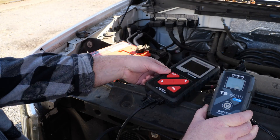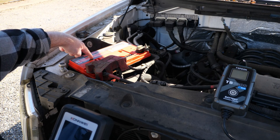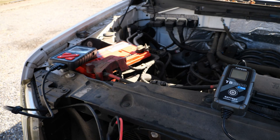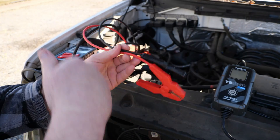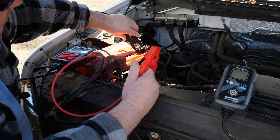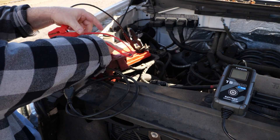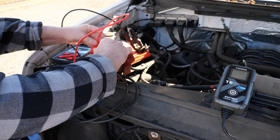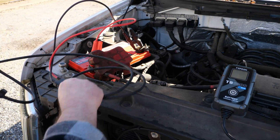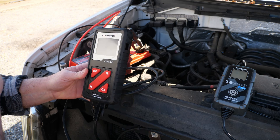This is a true multi-tool and it has a built-in battery tester, and this is a dedicated battery tester. The battery is rated for 950 CCA — cold cranking amps. These testers work on voltage and resistance; they don't load test a battery. It's a slightly different mode of thinking, but they're accurate — I've never seen one do it wrong unless you have a bad connection.